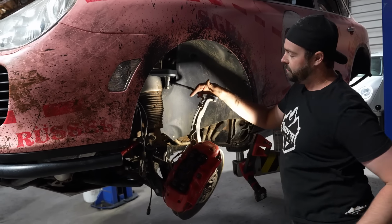So it is way past my bedtime, but we're getting this all done. We installed the lift kit in the rear of this. When we install the lift kit in the back, we do have to notch this basket to make the clearance for the air check valve, because we did drop it down a bit. So this is all relocated. We have to take about 20 millimeters off of that. And then once that's cleared and we put our lift kit in, we're gonna get it back in the car,